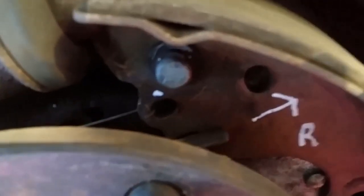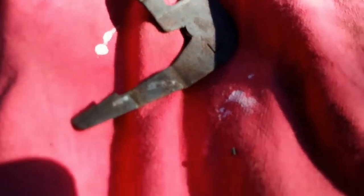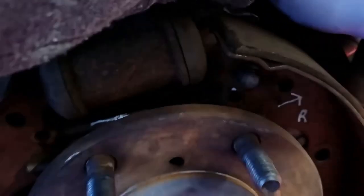The shoe's in place, and the springs are also in place along with the spacer. There's a spring being clipped around there, and there's the right-hand side of the spacer — you might just be able to make that out. There's the ratchet there that sits around that round thing and just levers up on it, tightening up the drum brakes as needed.